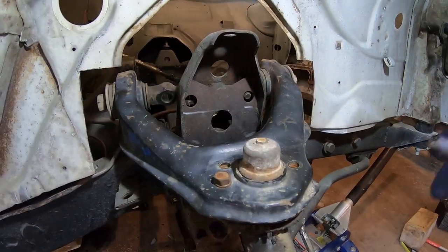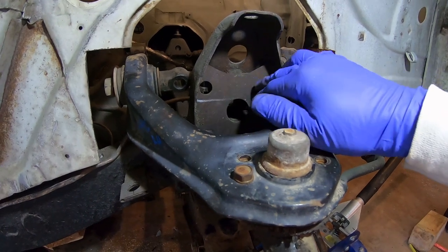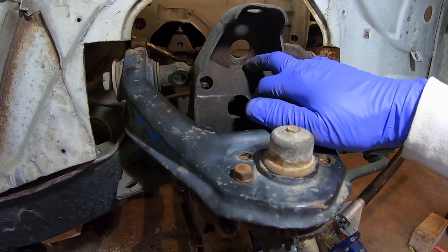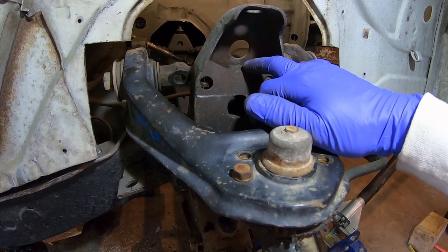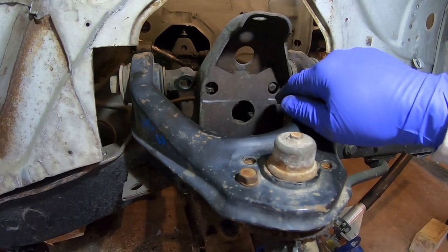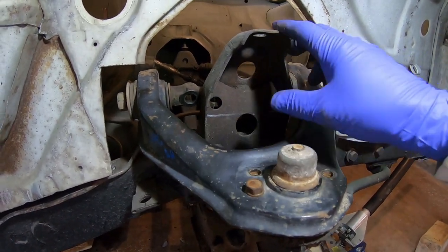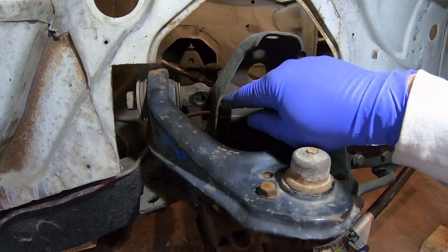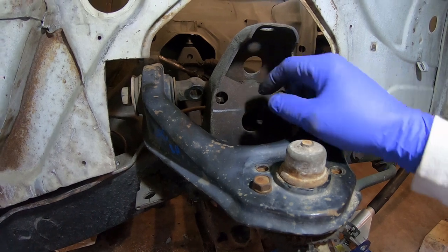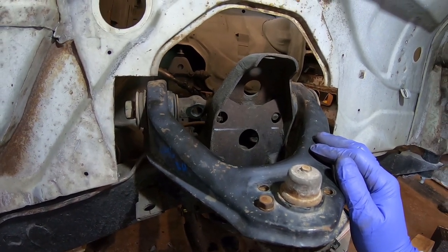Let's grab the stock shock. Here's plan A: I want to see if I can get that threaded bar cut out of there. I cut a bunch of those off my solid axle swaps and threw them away — wish I had some now. I'll just make one — get a piece of flat stock, really thick, a longer one that's the right length, weld it in there, clearance this area, cut the top off, cut that plate out, put the tower back on with a new longer one and reinforce it. That's plan A — seems kind of extreme, but that's the way I think this should be.